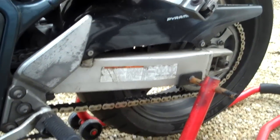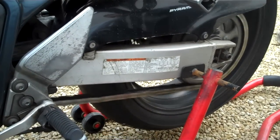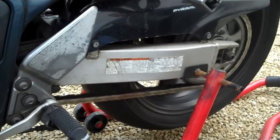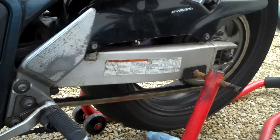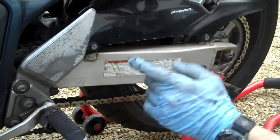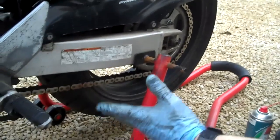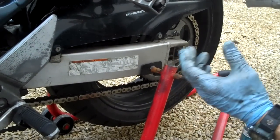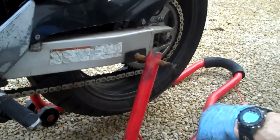Job done. That chain is now perfectly clean, correctly adjusted, and correctly lubricated — it even runs better. There's a loose spot there, but remember: don't adjust to the loose spot. There's the tight spot and that's your inch and a half — perfectly adjusted, perfectly cleaned, perfectly lubricated. Sorry if it's been a bit of an egg-sucking exercise — it's just to pass on an important piece of knowledge. If you haven't got it, get it done. Practice it, and mail me if you need anything covered again. Thanks ever so much for watching — this has been Del Boy's Garage, see you next time.